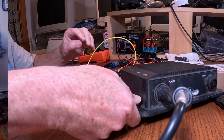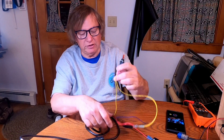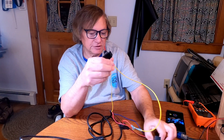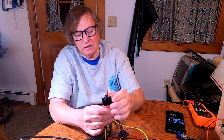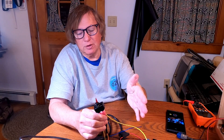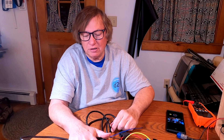This setup — I can plug an active target one module, active target two module, an S3100 module in, and everything works the same. Even a network hub, an NEP box, sonar hubs — all that stuff. All the Lowrance modules use this same type of power cord and they all have switch control on the yellow wire. So this is the way to use a switch in a really simple arrangement. The advantage of something like this is if you get the right switch, it's easy for a kayak or a small aluminum boat to let you switch it on and off. I appreciate you guys watching. If you like this video, please give me a like, and if you haven't subscribed, I'd appreciate a subscription.